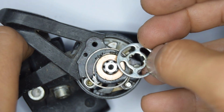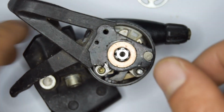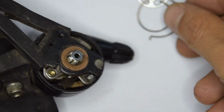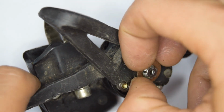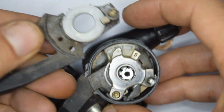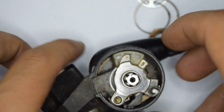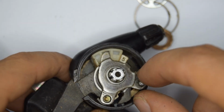First plate, there's a dot on the top there. Spring. You can now lift up the shifter, so there's a pull here, we'll remove that after. So here there's a little E-clip that we need to take off.